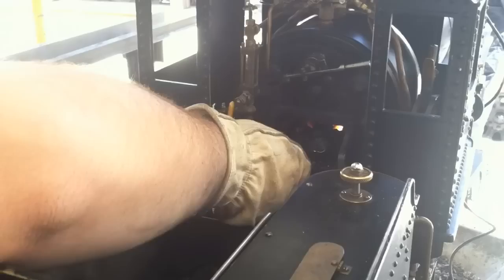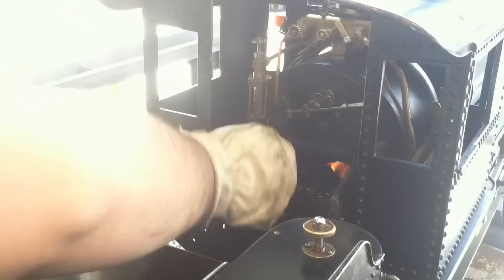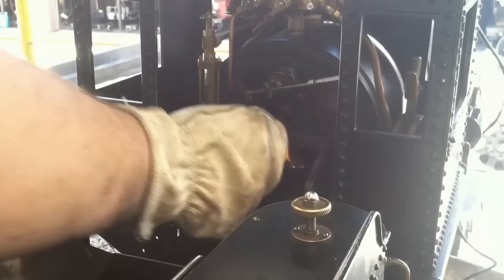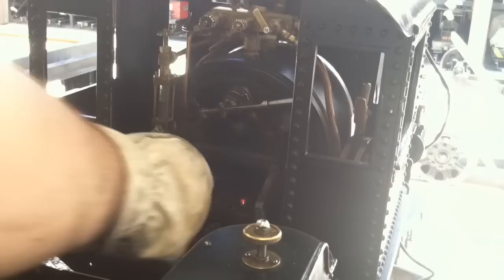One of the most crucial things about firing up is the transition from wood to coal — it's a difficult process to learn, and trust me, I've put out several fires myself by not doing it just right. You don't want to put in a ton of coal at once; just add gradually, and as the coal continues to catch, add more and more. When adding coal, make sure it gets to all points of the firebox — the front, the back, the sides, and the corners. The more even the fire, the better the heat transfer, and the engine will steam that much better. You want a nice, even, level fire.